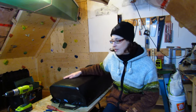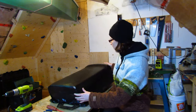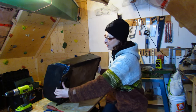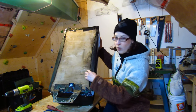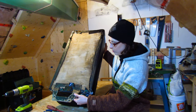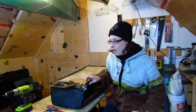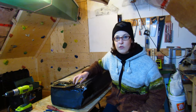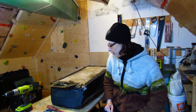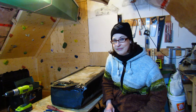Hey everyone, I'm in the shop. I brought the seat from the Bravo back here — the intention today is to recover it because, as you can see, the vinyl is really ripped up. It's been doctored up in the past but I think it's time to rejuvenate this old baby. You can see on this side too the wood is kind of getting rotten, so I'm going to replace that. I'm going to keep this original metal piece here because it's not really necessary to replace that at this point. So the next step is we're going to take off the old vinyl, take all the staples out, remove the screws from the metal, and some of the bolts in back so we can basically take it all apart. Then I'll use the old vinyl to trace it out on some new vinyl that I got at Fabricland, and we'll cover the seat. All right, let's get started.